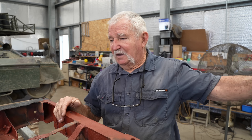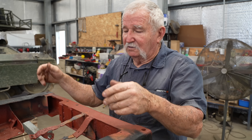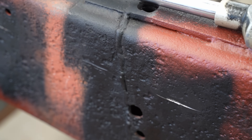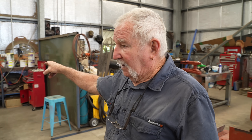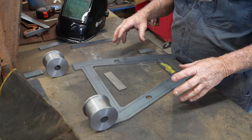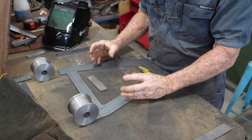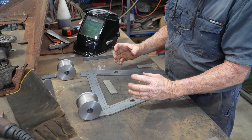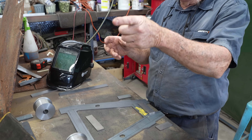I started on the bench first with the rear end, put it up onto the jig. We had uprights on it to keep it all the right measurement all the way through. Today we're working on an A-arm — this is the A-arm, this carries the wheels. Once this is all together, we're going to make up two circles 140mm diameter with about a 25mm riser which will centralise the two springs that come up and go up into the top of the chassis.